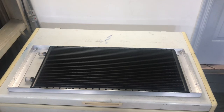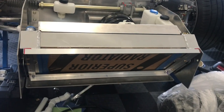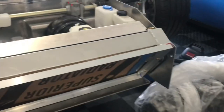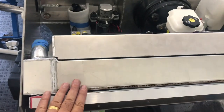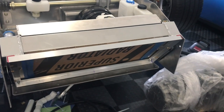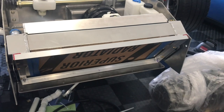We have the condenser bracket on the mounting points — nice clean install, didn't have to drill any more holes. I'm going to put some aluminum tape on top, and that'll force all the air through the condenser and through the radiator. So it's going to look nice, clean, and be functional.